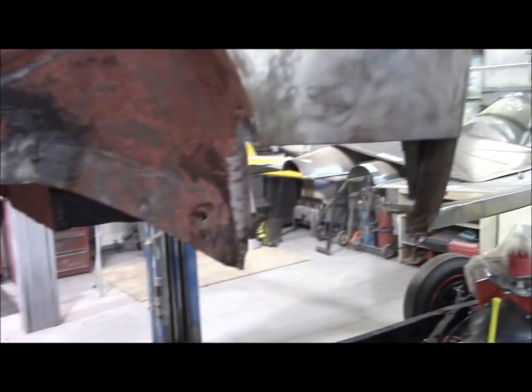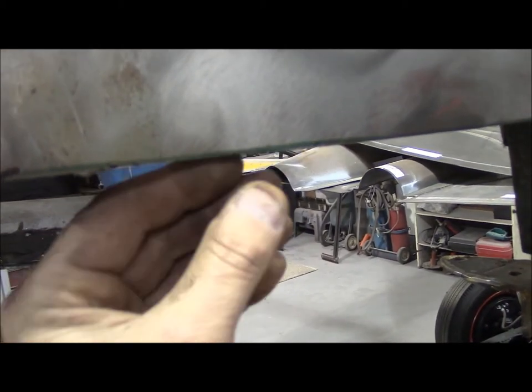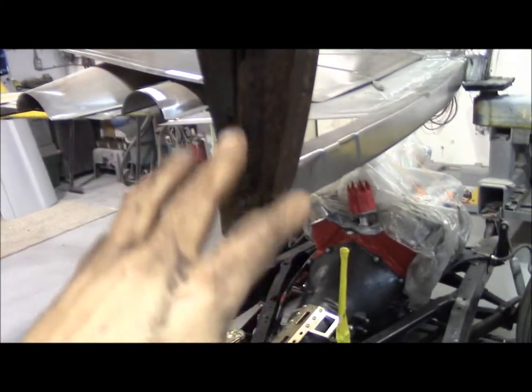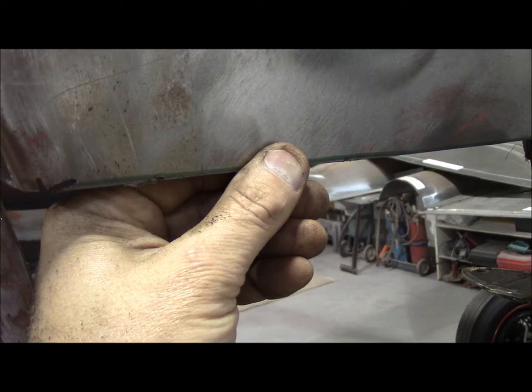We're going to do some trimming and some repairing on the inside here, then get onto this panel. There's the panel cut off — I still got to do a little bit of trimming up here. I always cut below the line, and you can see the green line there. This panel is still overlapping a bit, and what I will do is when I fix all the rust down in here, I'll lay the panel on top, make sure everything's good, hook her up on there with some good clamps and vise grips, and do my final trim along here with a very thin wheel and she'll just fall right into place.